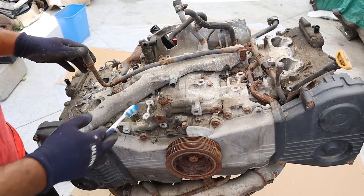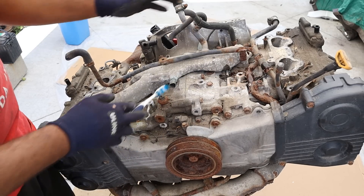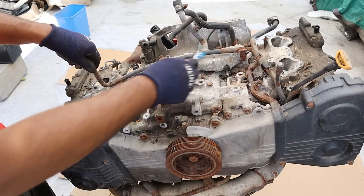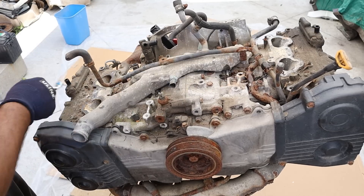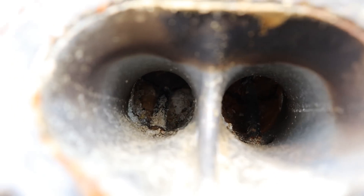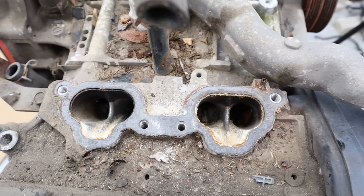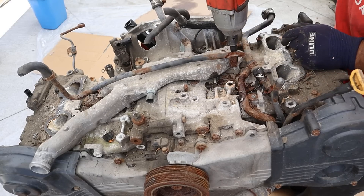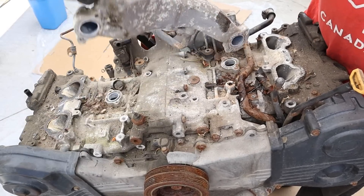With the intake out of the way we can take a look at the top of the engine. You can see a couple of coolant lines — they go to the heater core as well as the throttle body, and there's a coolant crossover here. Back here we have a PCV valve as well as ventilation on both valve covers. I did find a lot of coolant in the oil pan, and there's a lot of coolant residue and water evidence back in the intake ports — so this is going to be a really messy teardown inside. I'm removing all the bolts that hold this coolant jacket on, and now removing the coolant jacket crossover pipe.